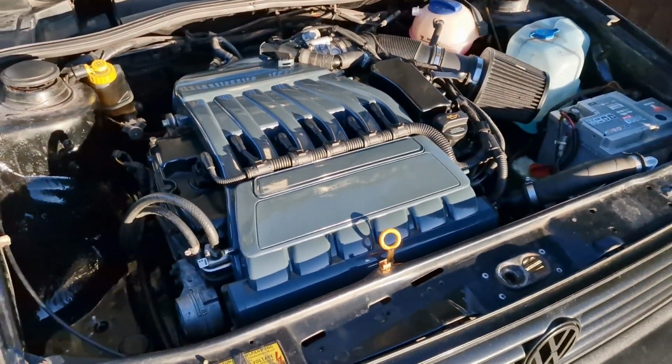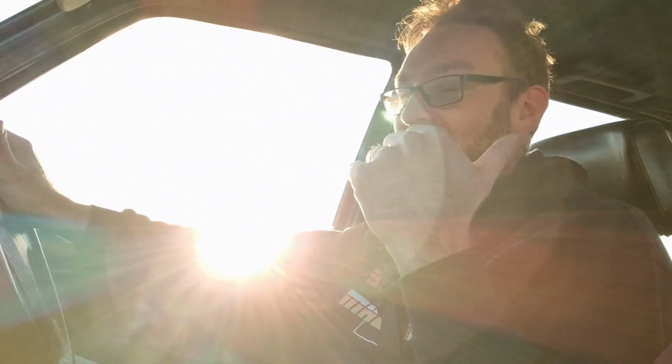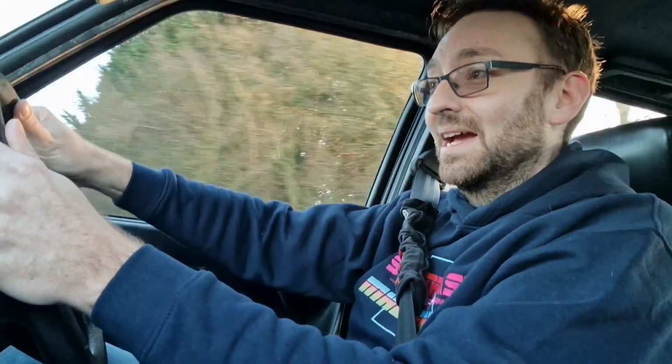And on this car, because we've got what is quite a substantial suspension setup, we have BC Racing coilovers and we've got massive anti-roll bars. We've got a 22mm at the front and 25mm anti-roll bars at the back. There is no sense of this car being nose heavy. The turning is spectacular, let's be honest. It will grip and grip and grip.